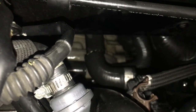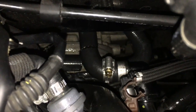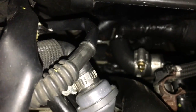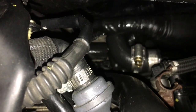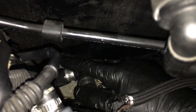The two hoses going to the firewall — you're just going to tuck those out of the way for right now, and just leave them in there like that. Now you're going to slide one of the hose clamps over this hose and a hose clamp over that hose. Put them in a position where you can get to them with your screwdriver or nut driver. Now that you've got the hose clamps on, you're going to take your 90-degree 5/8 adapter, bring it around, and put one end in the first hose like that, then take the other hose and slip it over the other end. After you get the adapter in both hoses, go ahead and position your hose clamps and tighten them up — both of them.